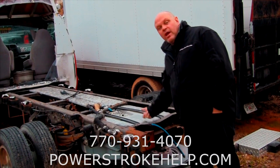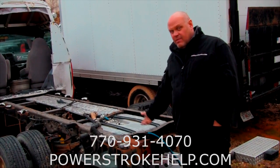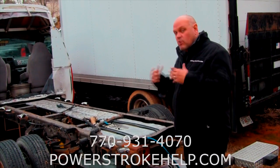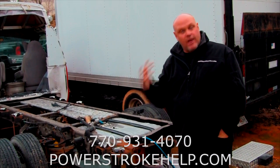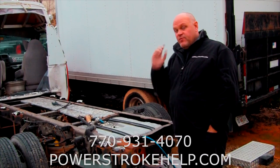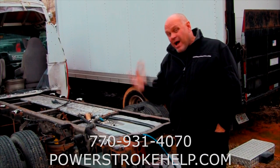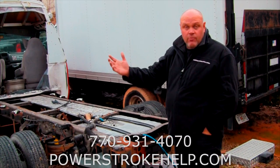The metal fuel tanks virtually remained unchanged all the way up to the late model trucks — I've seen plenty of these in 6.7s. The problem with these tanks is that the inner liner, a little coating inside there, will come apart and go up to the fuel lines and end up in the fuel filter. Sometimes, if you're not paying attention, it'll clog the fuel filter, and then the fuel filter will bypass. There's a little check valve on every one of the fuel systems of these trucks that will bypass and let the debris go by down the road.